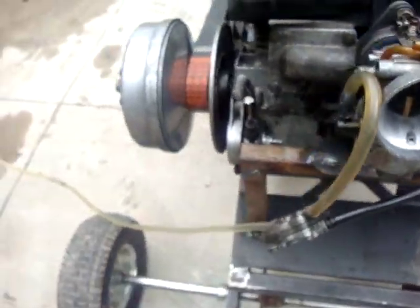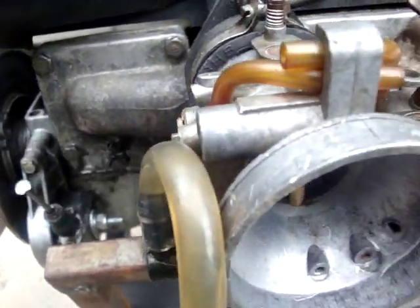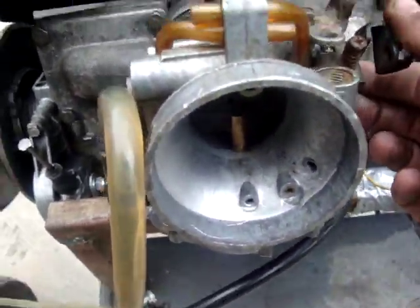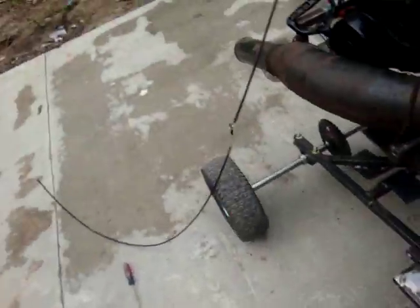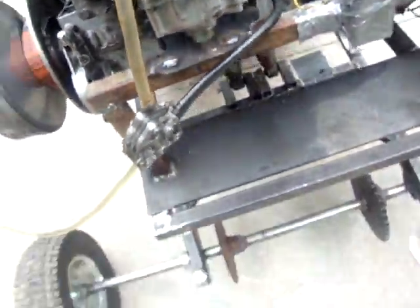One thing I also notice — I don't know if you guys know anything about this. It seems like I'm getting exhaust coming back up and through my carb. When she's running I can see it coming up and through. When I wrap the throttle, I don't know if it's just the motor blowing it over next to me or if it's just coming out from up inside there, leaking through. It's hard to see.